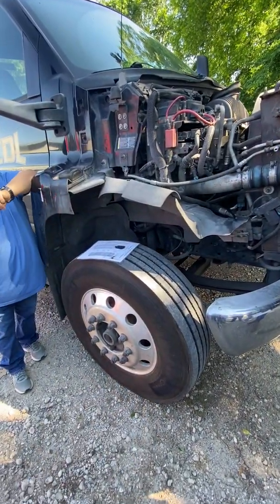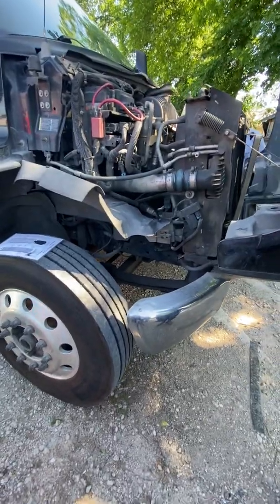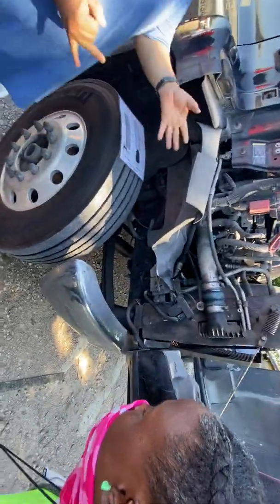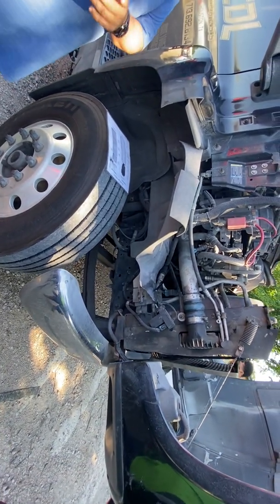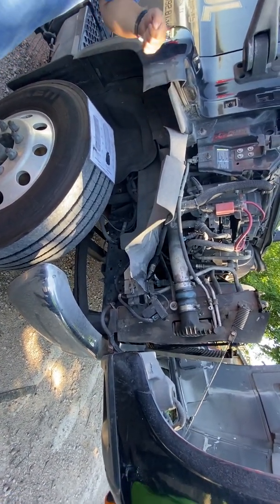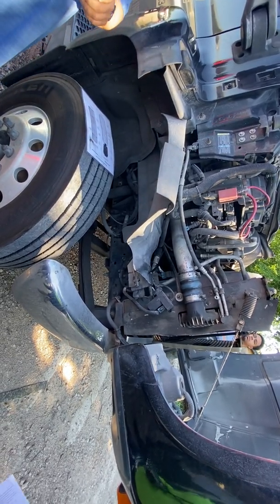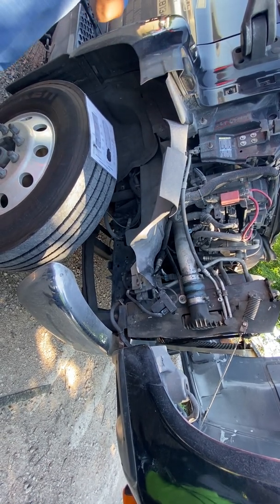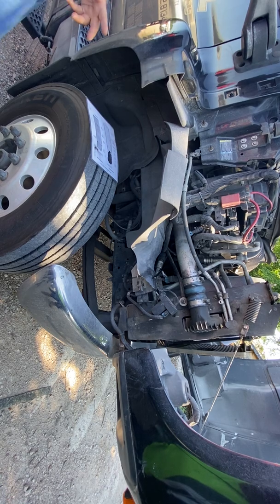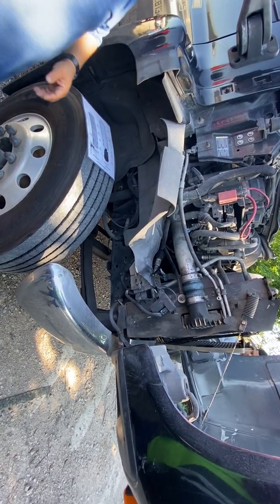Just tell them, look, again, the alternator, I'm going to make sure that it's securely mounted with the nuts and the bolts as well, so it's not loose or falling. Second, I want to check the condition on that alternator, that it's not cracked or broken, so it does work correctly. Third, the alternators have the cables and the wires coming from the battery connected to it. So you have to tell them I have to make sure that I check those connections, that they are clean of rust or corrosion, because I want to have a good flow of electricity from the alternator to the battery so it can charge them correctly.